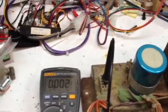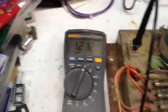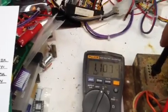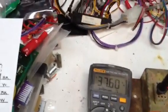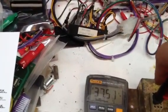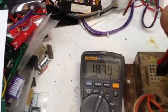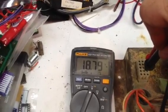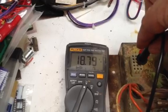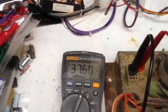For testing the 36 volts AC you need to shift your meter over to AC. You don't want to use ground when testing this AC, and I'm going to show you why. You want to test pin 6 and pin 7 together to get your 36 volts AC. If you take either pin 6 or pin 7 to ground, you're going to get a reading of approximately half, which is 18 volts. This is a big place where a lot of people make their mistake — they'll try and read this to ground, get half, and panic thinking they don't have 36 volts. Well, you don't have 36 volts because you didn't take the reading right. So 6 to 7 is where you want to read it.